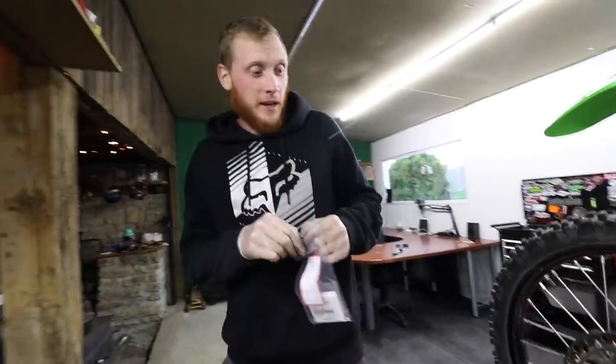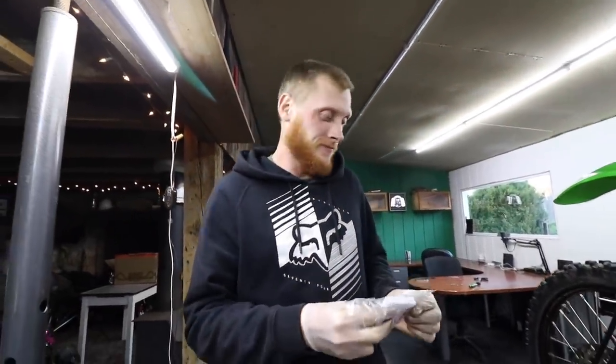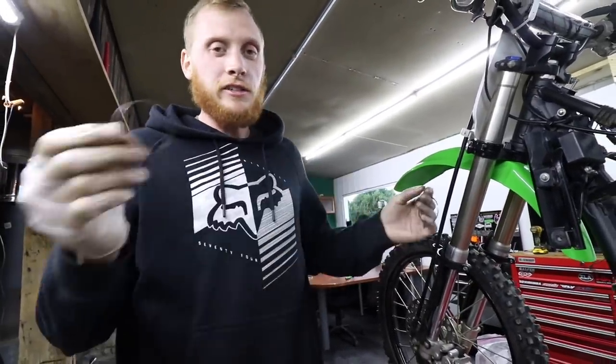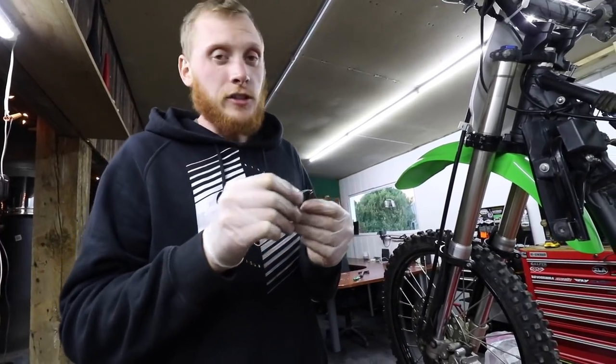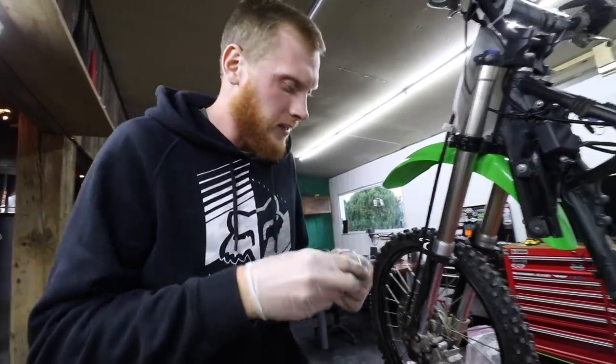He's flying! All right, Lex, what time is it? Two stroke time? Time to put the rings on. Now, when ordering rings and piston, you really want to check the ring gap, but since this is OEM, for the OEM cylinder, I'm not really going to worry about it. You should still do it because of manufacturer errors and whatnot, but you know what? We're just going to send it.